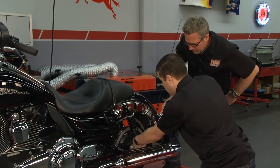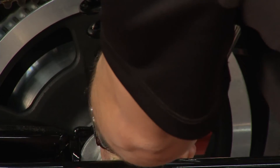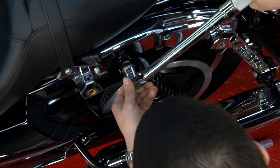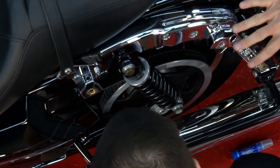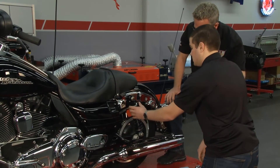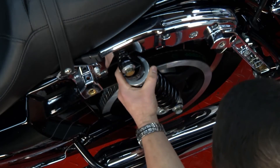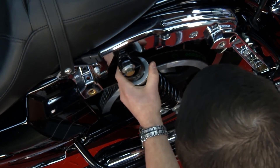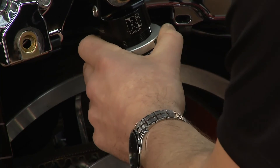Give them a little torque and we're done — we're going to torque this to 35 foot-pounds. Now how do you adjust? Well there are two different ways: you can adjust right here for ride height, which is adjusting the spring preload. Tighten more preload down onto the shock and it's going to raise the bike up a little bit.